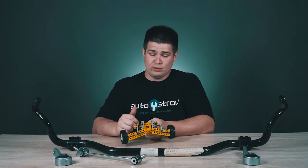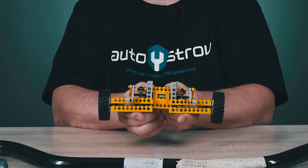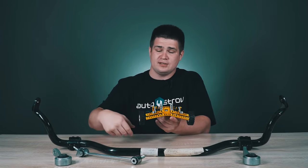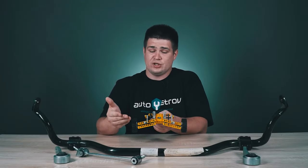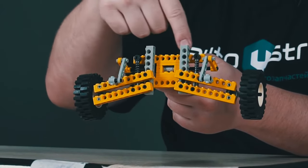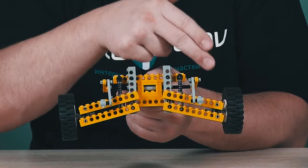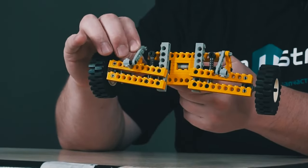Let me lift my model and show how it works in the air. When I raise one of the wheels, the other immediately raises. The sway bar has some elasticity, and due to this, the sway bar links and struts do not fully convey the kinematics from one wheel to the other side. I will raise the right wheel and you can see that the sway bar is also trying to raise the left one. But due to the elasticity inside, the range of motion is not completely transferred to the other side — we seem to have a connection, but it is not rigid.